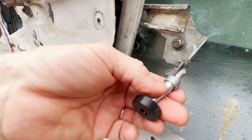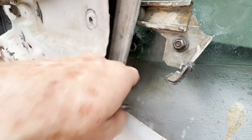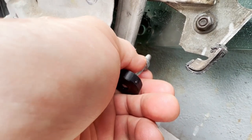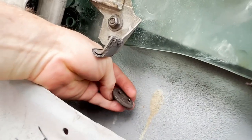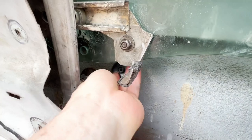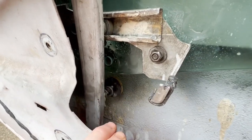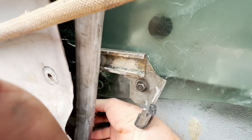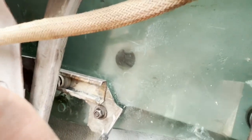If your original window roller breaks, all you'll have is the ball stud. You could probably grab it with vice grips to unscrew it. This piece goes through the glass and comes back through that way, and then you've got this on the front — so you could probably change this roller out without taking all this apart, as you see me sliding it out from the bottom.